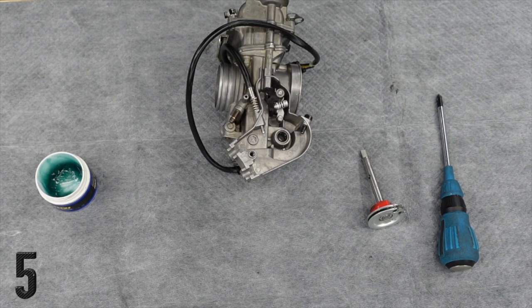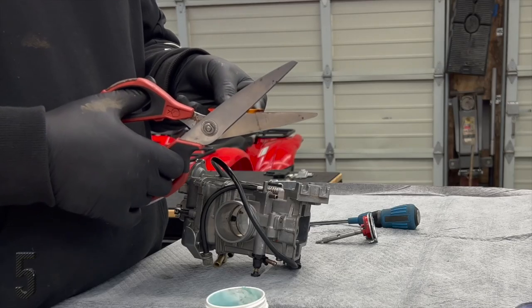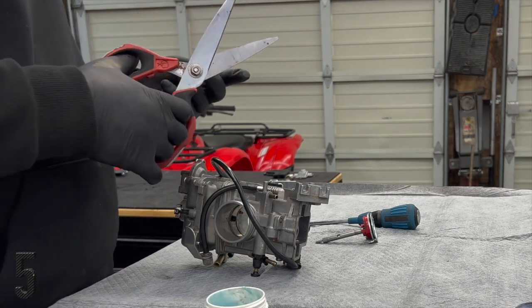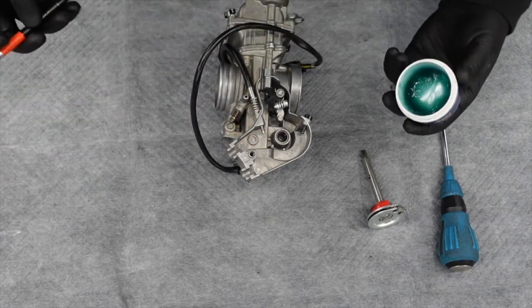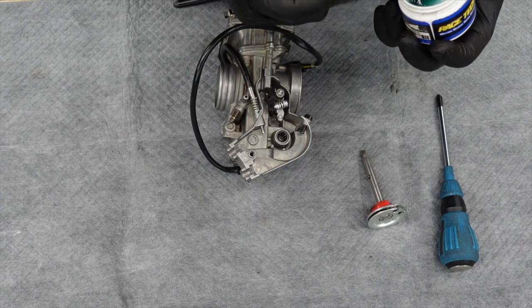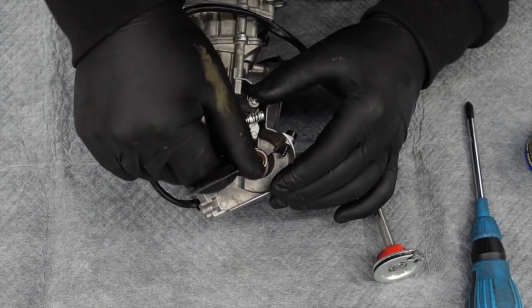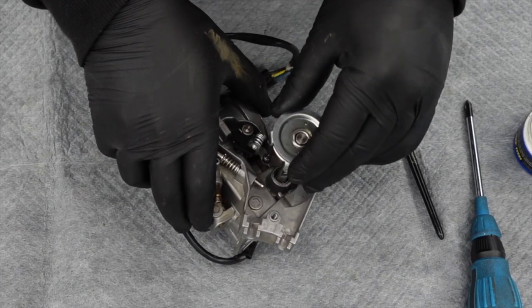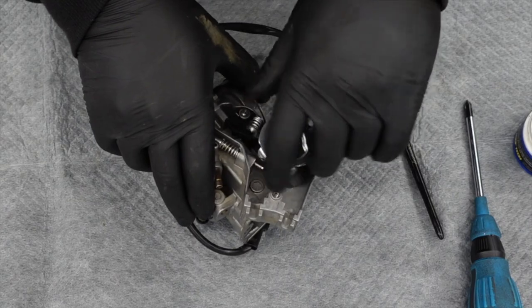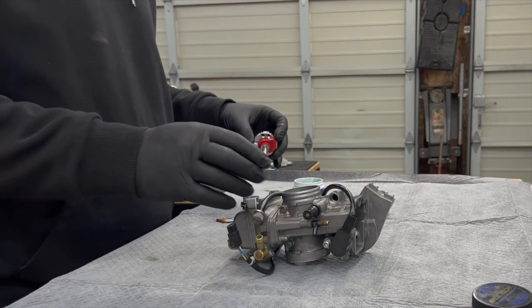What I'm going to do is make a minor modification — just make this kind of into a tip. We don't care because these are worth like two cents apiece. That's a little bit of a finer point there. We'll just get a little bit of grease on our brush, fit it in, and then spin it around so this guy can now slide in there. Give it a couple spins before fully installing. That's all nice and lubed up.